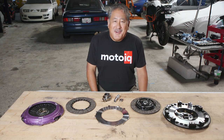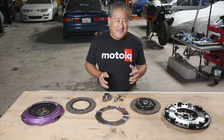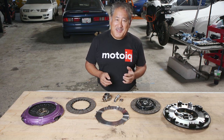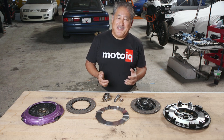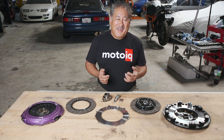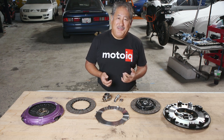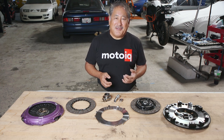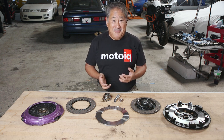High-powered multi-use cars often have a lot of problems with the clutch. If it's not the clutch, it's your left leg. A lot of times the clutch that can take a lot of power has a really stiff diaphragm spring and a lot of clamping force so it won't slip. This means the clutch pedal effort is high — high effort, your leg gets tired, it slows your shifts and makes the car very difficult to drive for long periods of time, like in bumper-to-bumper traffic.